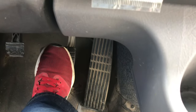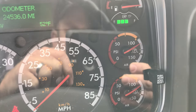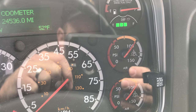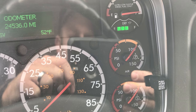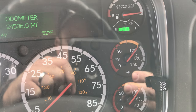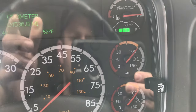Now we put our foot on the service brake, push and hold it for one minute, looking for a leak of no more than 3 PSI. Push and hold, then start your one-minute count. These needles are sticking tight — they're not moving at all — so that's great.